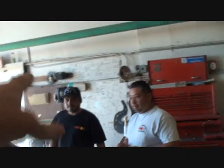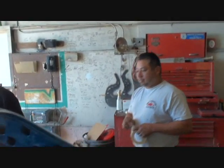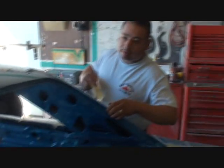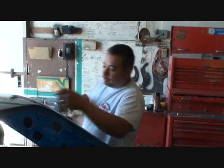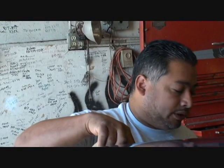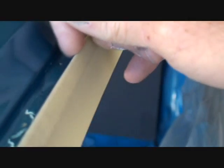When you put a headliner on, do you wrap it around the edge or cut it so it wraps around? We take these clips off, put them on there, and then cut for the clips. In the gutter rail, we trim it to the edge, then the body guy comes and seals it with silicone, and then the chrome molding goes over the vinyl top.